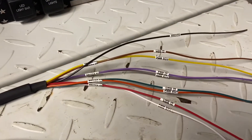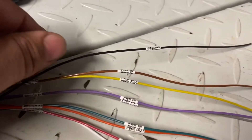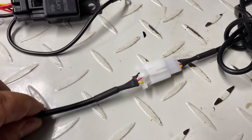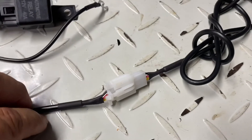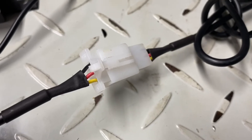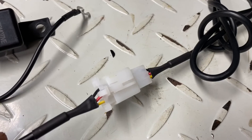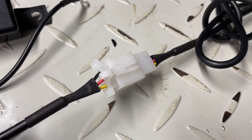What you will have left are the flying leads, which are all labeled for easy identification. The ground wire — all grounds will be combined into this one ground wire. Simply connect this to a good ground. On your relay wiring harness and the wires running to the switch, you will not use that switch — simply discard it. Cut the wires, expose your three wires: ground, power in, and power out. The ground wire will not be used, as you have a new ground wire with your new power cable and switch wiring. That leaves you with the two switch wires: power in and power out.